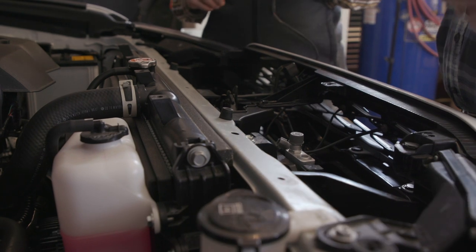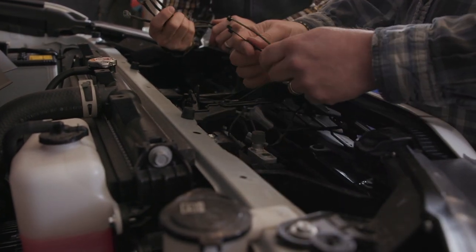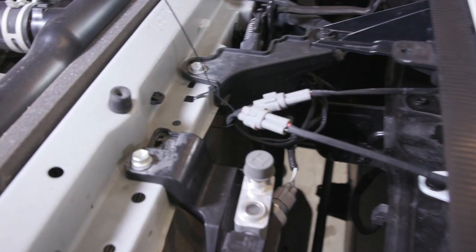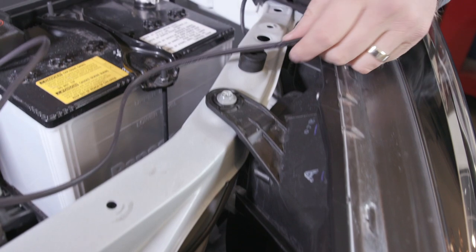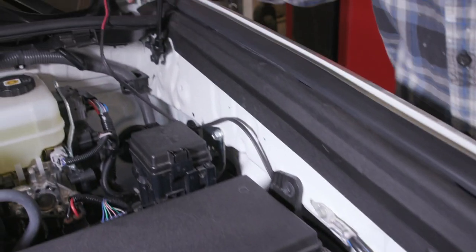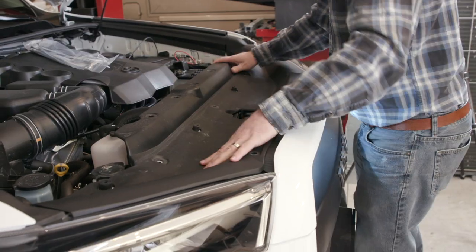When running the cables we want to avoid anywhere the cable can get pinched, cut, or interfere with things like the hood latch. The connectors are weather-tight and we found factory zip-tie locations in the body to route the wires cleanly up and out of sight. We got all four raptor light wires connected, then fed the main wire for all four lights behind the headlight and around the battery. Before putting the cover back on, we temporarily connected to the battery to verify the lights were working — and they looked great.